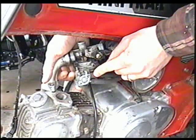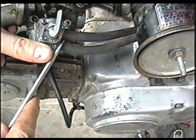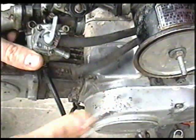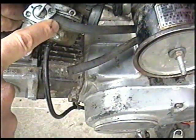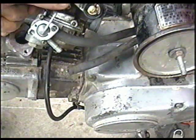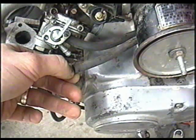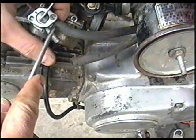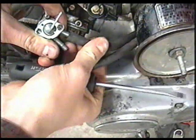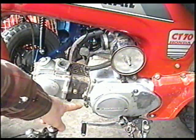Next you have the two fuel lines to remove. Usually there's a fuel clamp here but there isn't one on this bike, so I'm just going to pop them off with a screwdriver from this end and then pull it out. Remember that the fuel line with the little lines on it goes on the top for the reserve. Usually you've got fuel in the fuel tank so make sure you have a container to catch that gas when it comes out. I've already drained the fuel tank on this bike so I don't need to do that. Now the whole carb is going to come out — the overflow line is going to come out from this clip here.